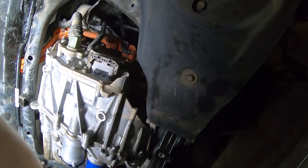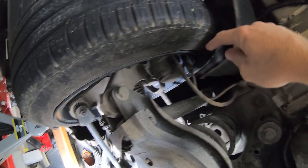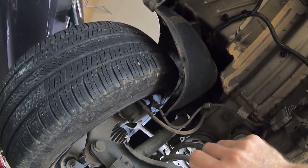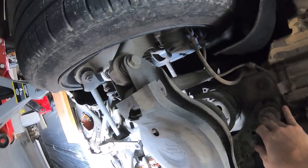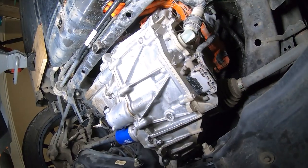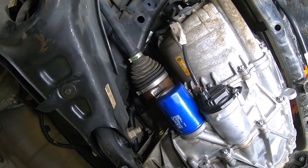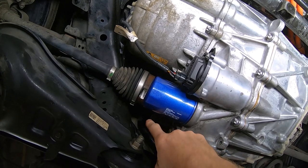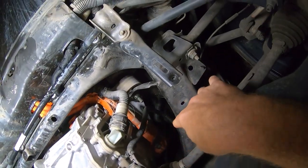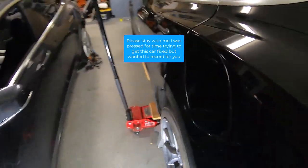Later in the video you'll see where the cables got hung up in the motor frame. If I disconnect the brake caliper from the rotor it can just hang and I won't have to worry about disconnecting the brake line. Once I take these four subframe bolts out I can drop everything down — just a coolant line and high voltage connector to disconnect. These other coolant lines are long enough since they go up and over. One coolant line hooks above the heat exchanger, the other near the high voltage connector at the bottom — that line should be left on and removed from the battery tray connection.